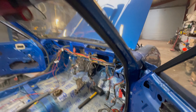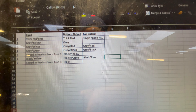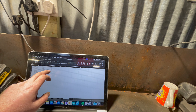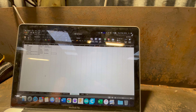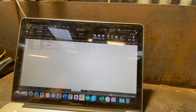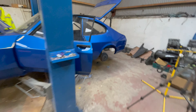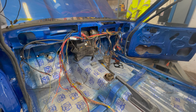There were only really four or five wires on the top side of the fuse box, which are side lights and stuff. On the top outputs all we've got really are four wires. One of those is the reverse light switch, which isn't being used — I'm running another one for that. Grey-black is going to be the side light for the front over the rear, grey-red is also a side light for the front, and the single-speed red I think goes to the washer bottle. So it's all simple stuff to wire in.